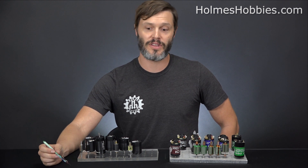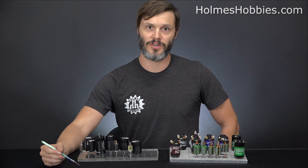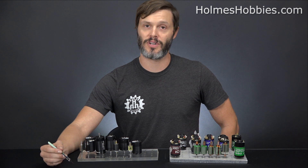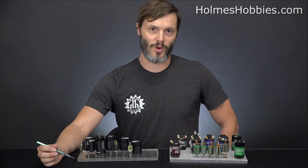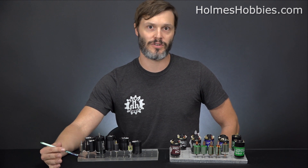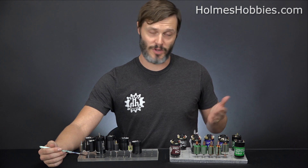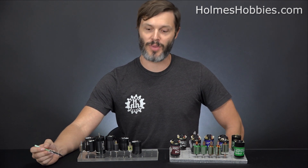We're also going to work through choosing the optimum speed, which is going to be the kV or wind of your motor depending on your needs, and also what style of motor to choose depending on what you're doing with your rig. We're really in the off-road truck market and the rock crawler market, so it's tailored to that style of 4x4 truck — really the only market that still uses brushed motors.